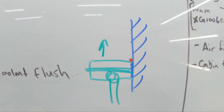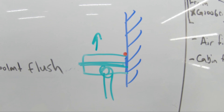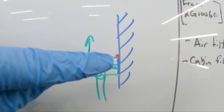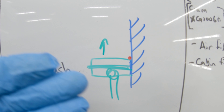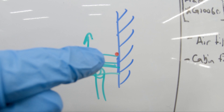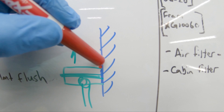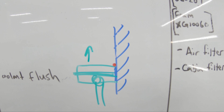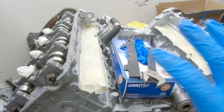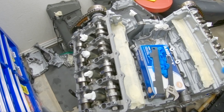I'm going to show you an illustration as to what I mean. The blue is your cylinder walls, the green is your piston, and that little red thing is the shrapnel. By me rotating the engine to put in those slots, there could be a piece wedged right against the piston and the wall. By moving up I don't want to drag that red shrapnel all the way up and continue scarring even more of the cylinder wall. I know there's already damage and the walls are probably already scored up, so I hope that analogy made sense as to why I'm not going to rotate the engine to its timing position.